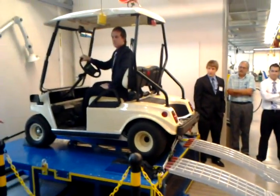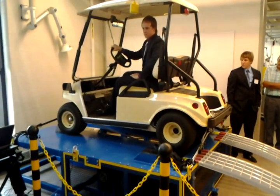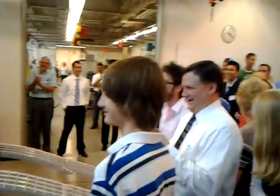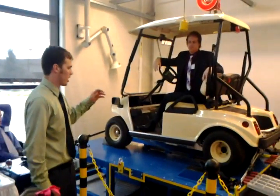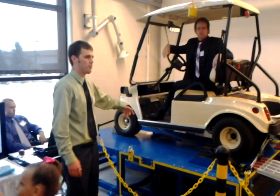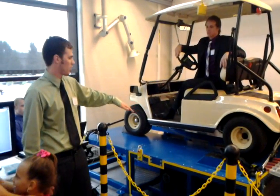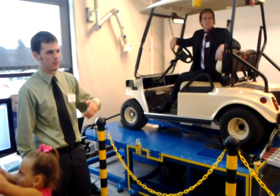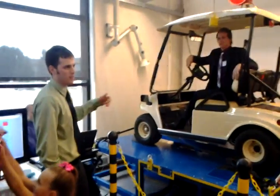Now the vehicle is at top speed and we're going to hit the emergency stop. Unlike a typical e-stop, which would cut all power in the system, our objective is to quickly and safely bring the whole system to a halt. So we actually increase power to the brake — we increase it to its maximum current, which is about 192 volts at 21 amps, which decelerates the system as quickly as possible. Ten seconds later, it's assumed the car is completely stopped, and it cuts all power and saves the data.